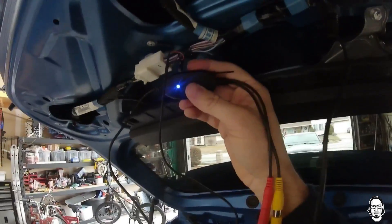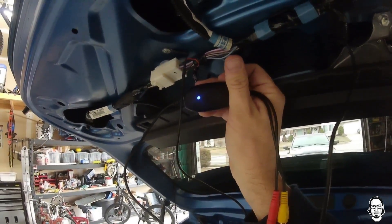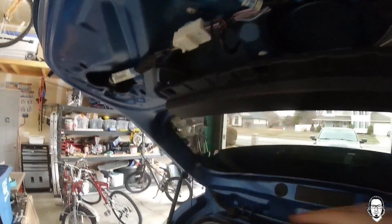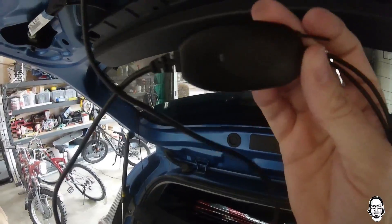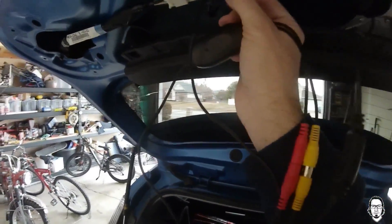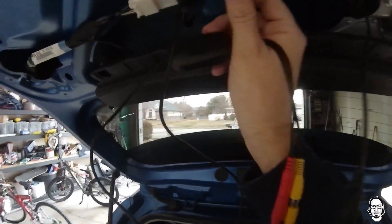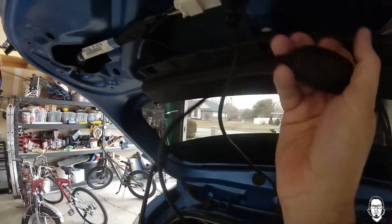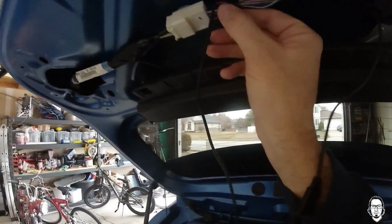I do know this terminal is off when the car is not running and on right now. I'm going to turn the car off to verify that again. Okay, my power light is off, so I know this terminal is only on when the car's power is on. I don't want it on all the time because I'll drain my battery — I just want it on when the car is running. I'll turn the car back on to make sure my power is good.